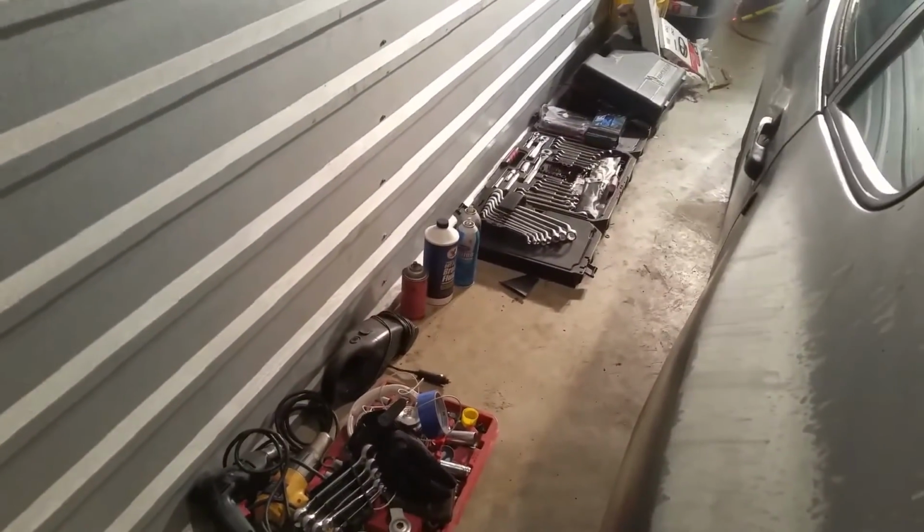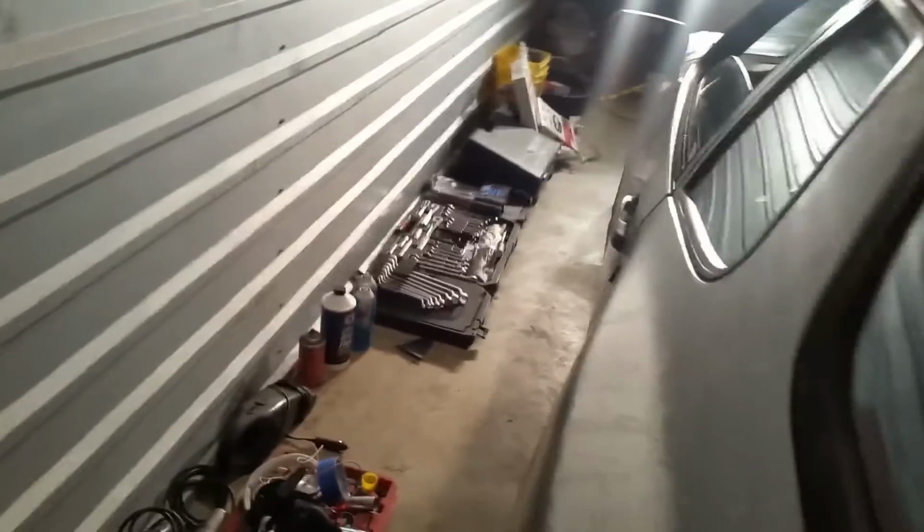You have some other little marks. You just want to sand everything down so you don't have any huge lips. The Plasti-dip's going to do a really good job, but the proof is in your prep work, okay? So coming around the back, it doesn't look too horrible. I just got some rust right down there. And as we come around, the same thing around here. This side is actually a little bit cleaner. There's no problems really at the bottom.